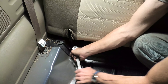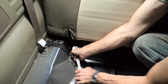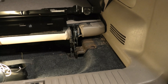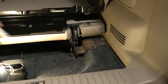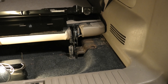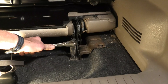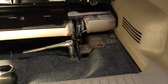Mission accomplished, and it's out. Now we're going to fold the seat down like you would when loading stuff, and we still have some more hardware to remove. Here's a nut we have to access, which now with that metal piece moved and the small bolts out, you can get in on it with a deep well socket. Once we get on this with the ratchet, this should turn off a lot easier than the other bolts since it's on a stud protected inside the vehicle. And yes, that's definitely not near the issue — it's turning right off since it wasn't exposed to weather.